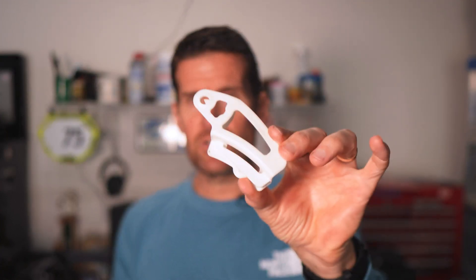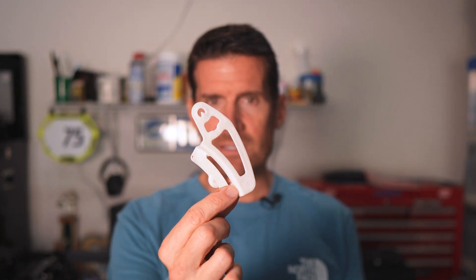So I'm going to use this tool to set the B-Screw. Now, I will mention that you're supposed to do this with the bike at SAG — in other words, you're sitting in the saddle. So really, it takes two people to do this right: you sitting on your bike and then someone else making this adjustment.